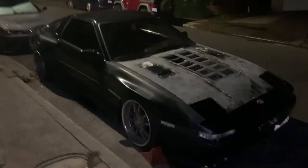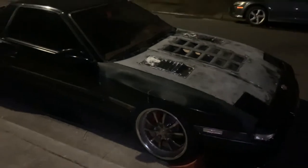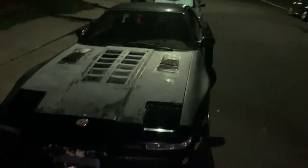The Supra is officially all done - well, kind of. I still have to get it properly aligned, but I did use those toe plates and they worked pretty good. Drove it to an appointment last night, drove to work and back home - it has a lot of angle, I'd say about 50 degrees or so. One thing you have to be mindful of when doing your alignment is to have your steering wheel completely straight and make sure there's equal play left and right, otherwise when going straight down the road your steering wheel will be cocked to the side. It does drive straight with a slight amount of toe in - nothing crazy, still very drivable. Shout out to Agile Performance - thanks for watching, please like, share, and subscribe.